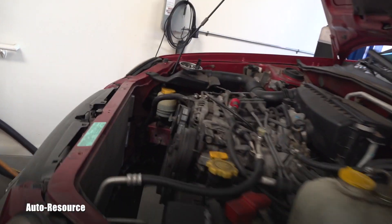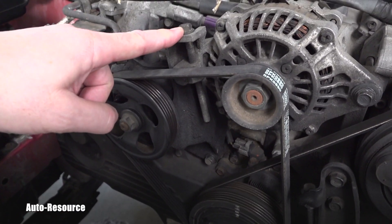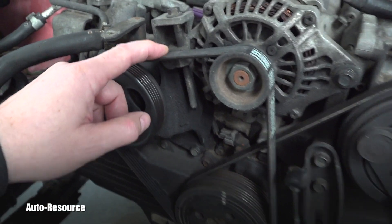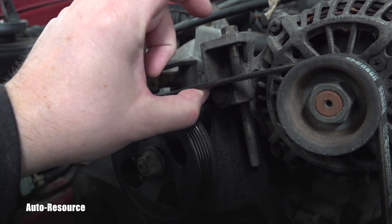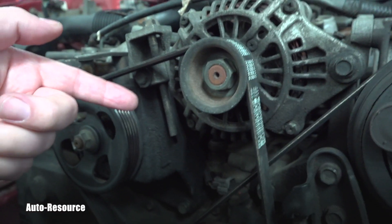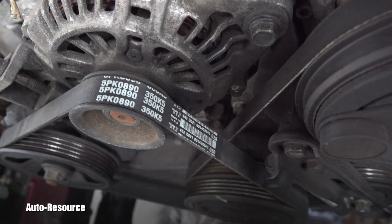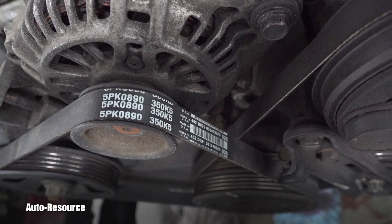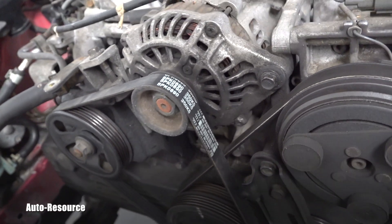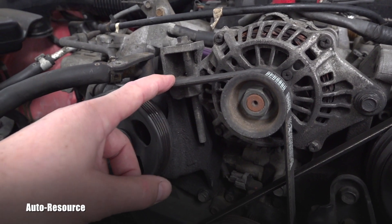This is a thing I keep seeing on these EJ25 engines. What I want to discuss is the alternator tensioner — specifically the bolt running into the belt. If this belt was loose today, I could not continue putting tension on it, because the head of this bolt needs to travel up; the whole alternator has to travel up, and it will start rubbing into the belt. I believe this belt was correctly ordered from an aftermarket store — it's not an OEM belt — and I don't think the person made a mistake, because I've seen this before.